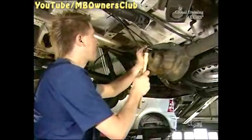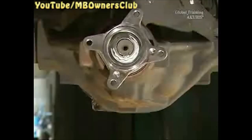Now the radial sealing ring can be removed. For this, remove the protection of the 12 point nut and unscrew. But attention — please do not use an impact driver for this job, otherwise the axle drive could be damaged. A hold wrench together with a torque wrench are the right tools for this job.